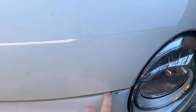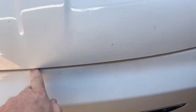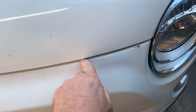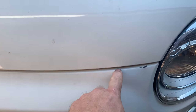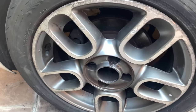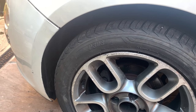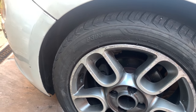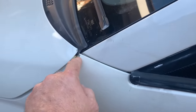There's a little dent there that I need to try and pull out. A couple of little bits to touch up. The alignment's not too bad, but it needs sorting out a little bit. It's a little bit too high still, or rather the bumper's still too low. They used some washers, but they put the washers on the top. When I do it, I always put the washers underneath. I'll show you in a minute when I get the bonnet up. I'm going to give the whole car a clean first, and then we'll go over them with a bit of paint. I'm not going to spray them, I'm just going to touch them in with a brush. A couple of little bits on the bonnet and on the bumper there to touch in. I've got to sort out this little bit of paint here.